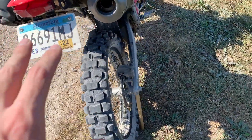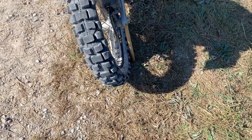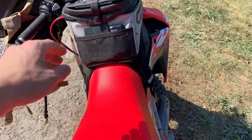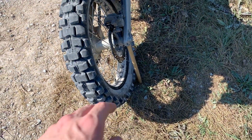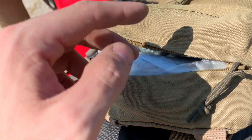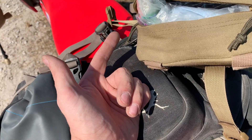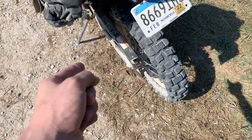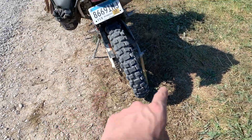Let's recap. What makes this different from doing it in the shop? One: a lightweight stick to prop up your tire. If you're in a wetter climate, you might want to double up on your load spreader — the little patty you put your kickstand on to keep it from digging into the dirt or pavement on a hot day. You want a small brush that fits easily in your tool bag. Some extra paper towels are really handy but not exactly necessary. Then a solvent and an oil — you can go with a two-in-one system, or do what I do and use kerosene and gear oil. Whatever you do, make sure you clean up after yourself and stay safe, because you don't want your fingers pinched and you don't want the bike falling on top of you.